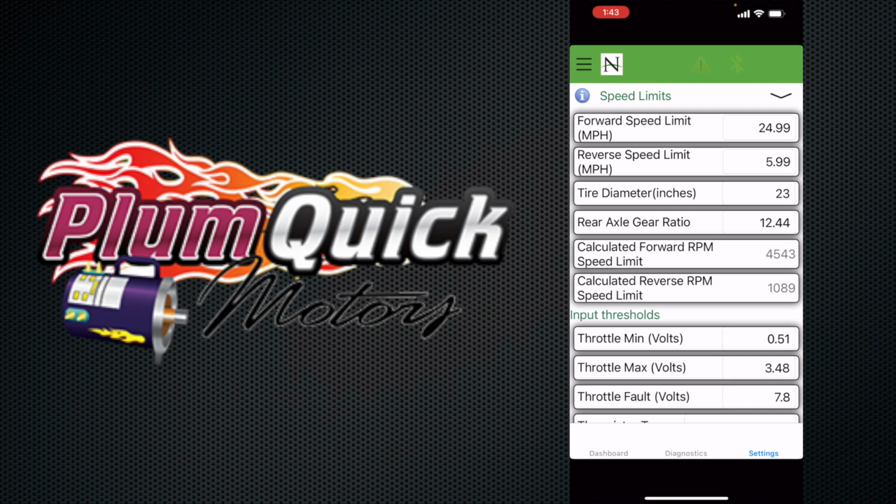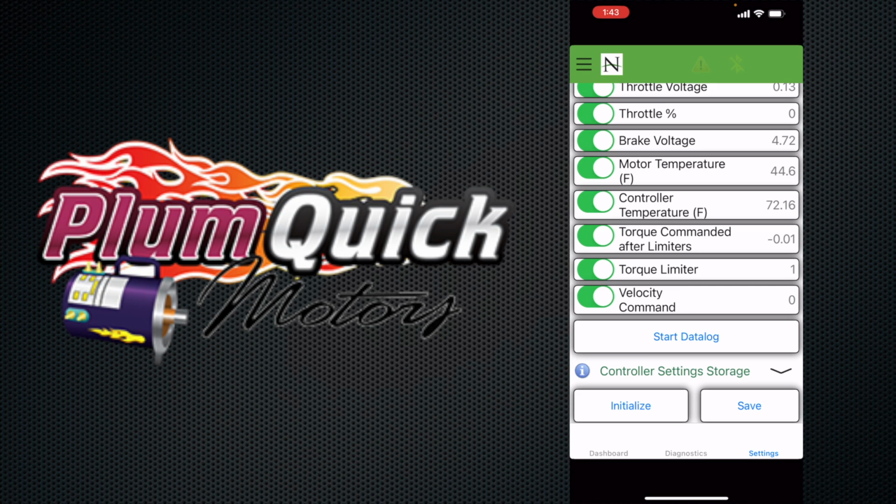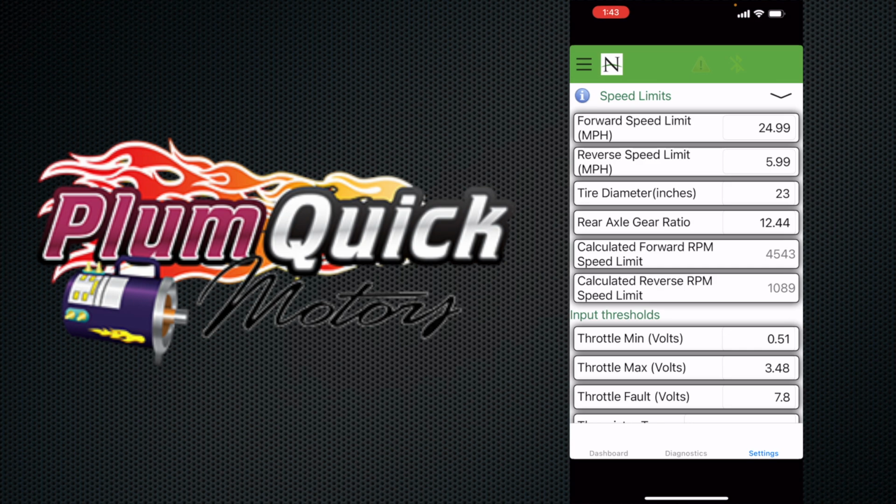Once you get all the way done with that, come all the way to the bottom, you can hit save, hit yes to save changes. Once this is done saving changes, we're gonna turn the golf cart off and back on. And then once you go to dashboard and come back to settings, it's already changed there at 23.